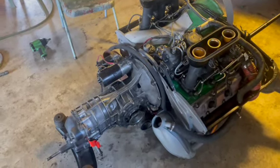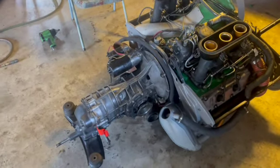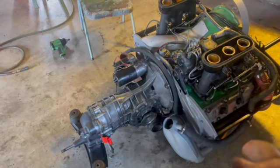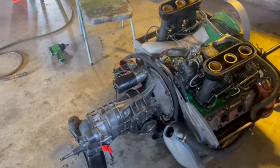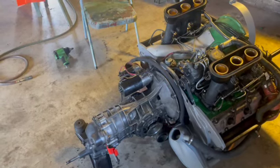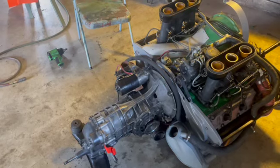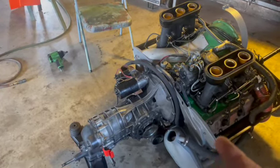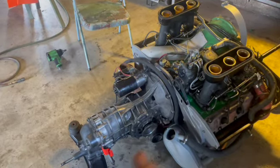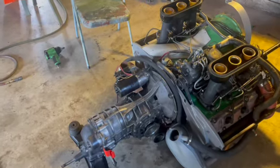And so after I pulled it off, I checked the splines on the clutch. They're good. I held the alignment tool on there real good before I torqued up the pressure plate to 16 foot-pounds today. I knew I was on the money. I knew my splines were right for my clutch. I knew everything was good. She went right on. So I must not have been lined up as good as I thought I was yesterday.